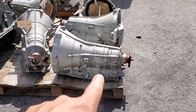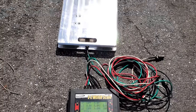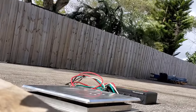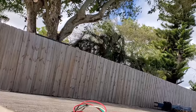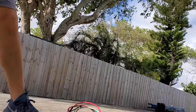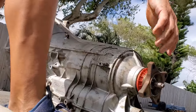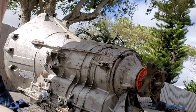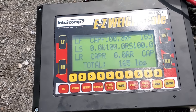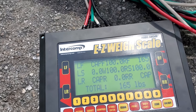Because I wasn't going to haul the DCT back over to the scale I brought the scale over. I'm choosing a 6R80 that does not have a converter in it. I'll film it so you know there's no trickery. This is going to be lighter than the 10R80 — I'm guessing maybe 150 pounds. The 6R80 comes in at 165 pounds, so the 10R80 is heavier by about 10 pounds. The MT82 is the lightest at about 133, the 6R80 at 165, and the DCT over 200 pounds.